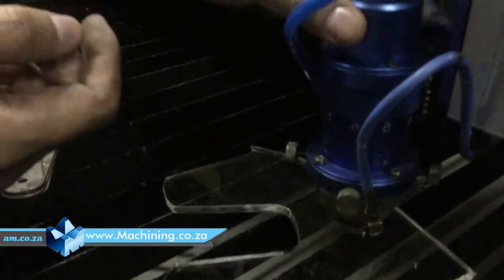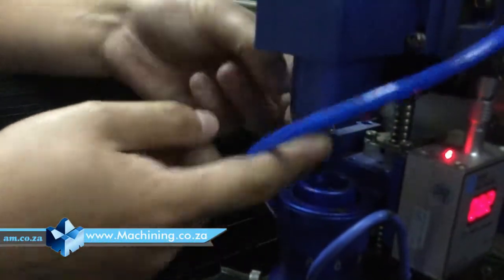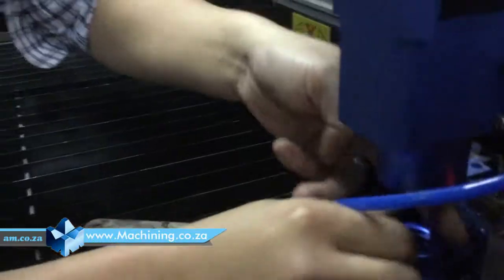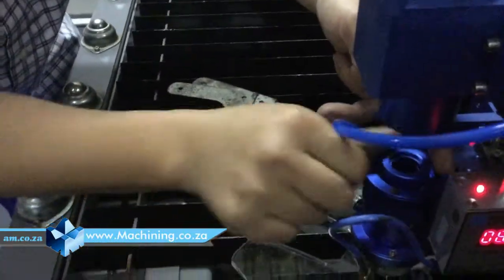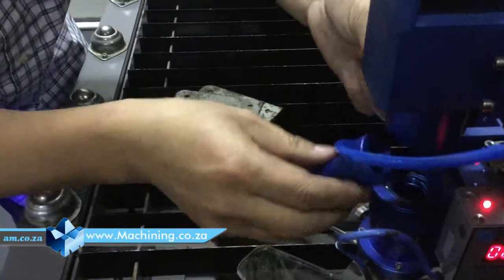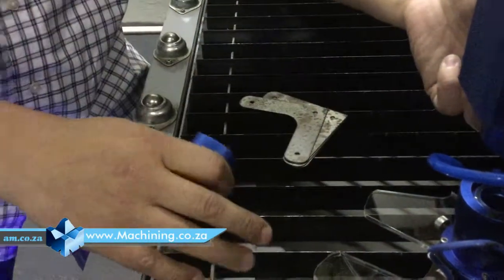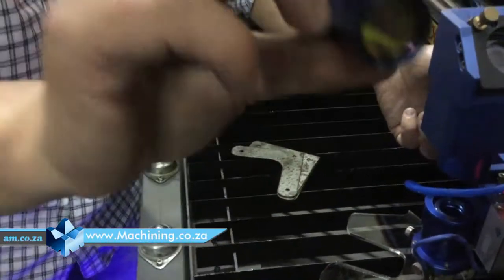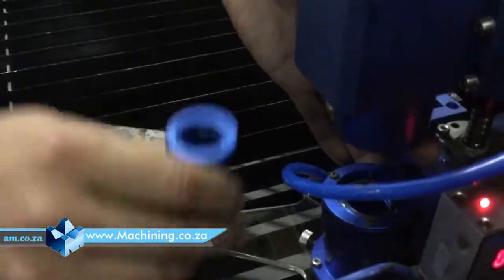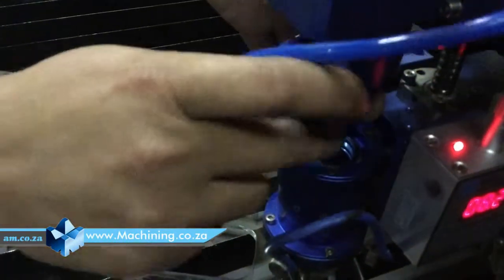Now where's the lens? Actually, this one you can take it up — the lens is here. This is how you take the lens out for cleaning. If you do not have enough space to clean, of course you first lower the head. The lens is inside here, you can see. So this whole thing will lift up or down to adjust the focus.